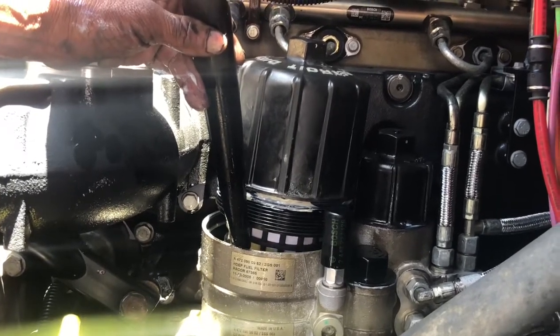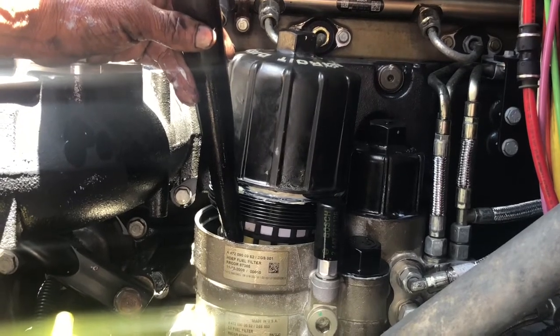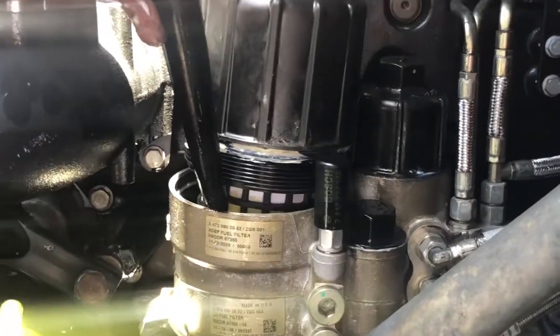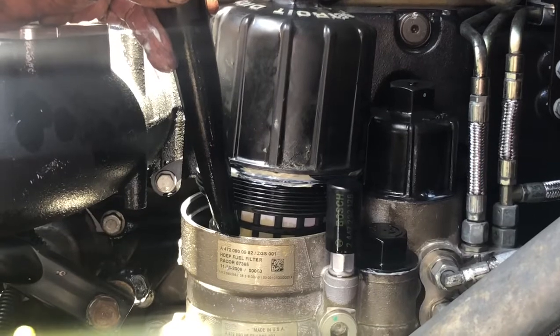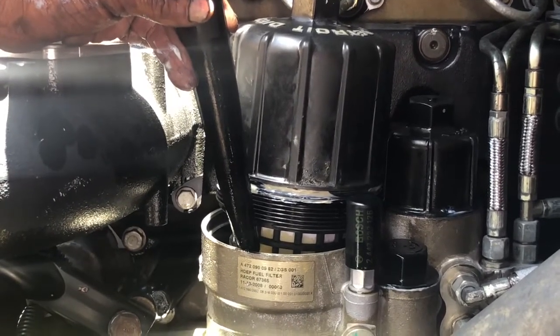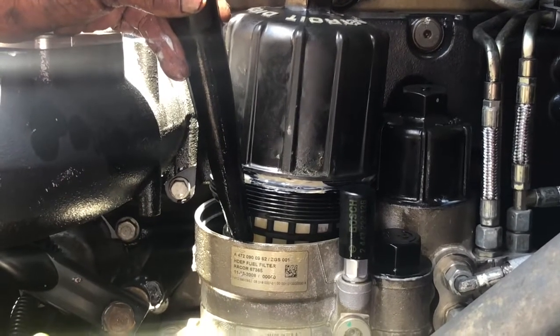The reason you do that: when you start the truck, before you start it you need to prime it. You can do that using the little primer pump. But pre-filling it minimizes the time to prime and gets you a nice strong start. So fill it up with as much diesel as you can without spilling or overflowing — it will make your startup a lot easier.